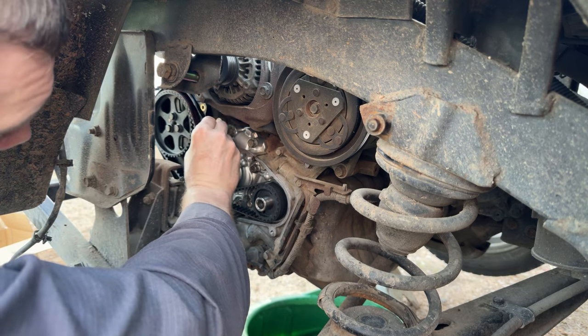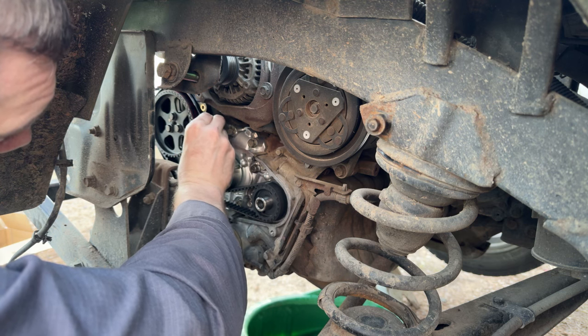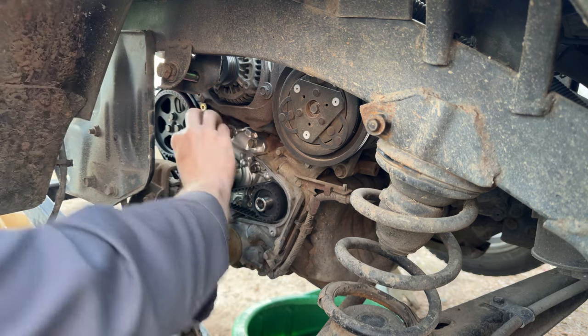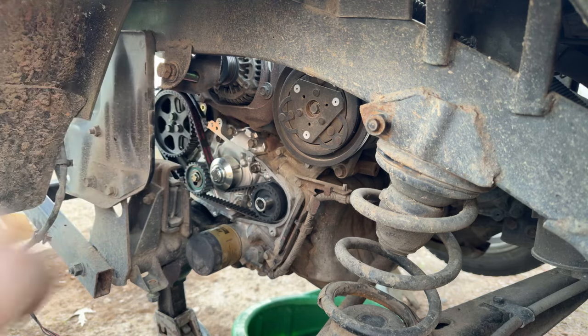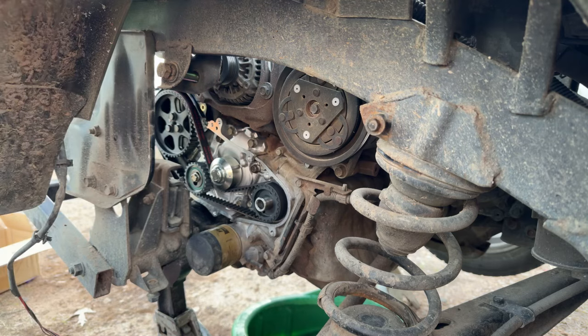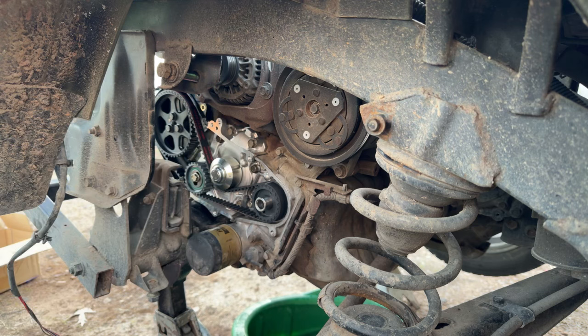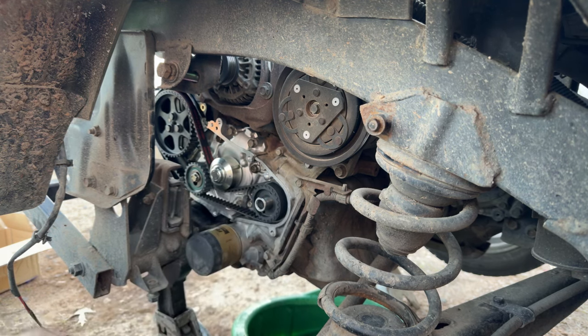But let's slide this seal back in there. I'd rather have seals on the top and not the bottom, just because normally junk's gonna come from the top down, leak inside. So if we can protect it from the top down, that's better than not. So got that in there. This seal at the back, it's at the back and it's low, so I'm not too terribly concerned about it. Again, we weren't provided with one. The one we have is swollen and crappy. If anything, let's go ahead and just cut the bottom part off and at least put that in to block that. We won't worry too much about the top part of it, because if stuff's gonna sling up, get in there anywhere, it's gonna be at the bottom anyway. So if we can protect the bottom at least, we're better off.